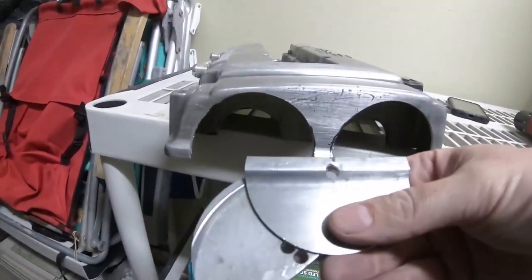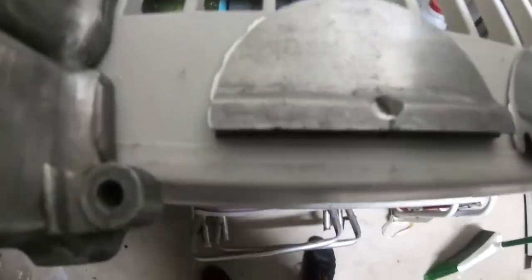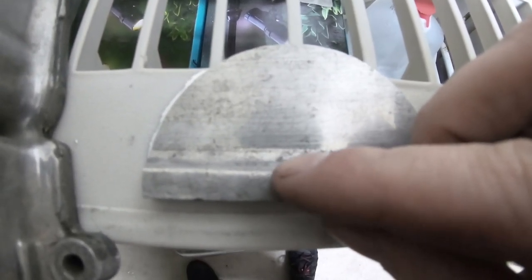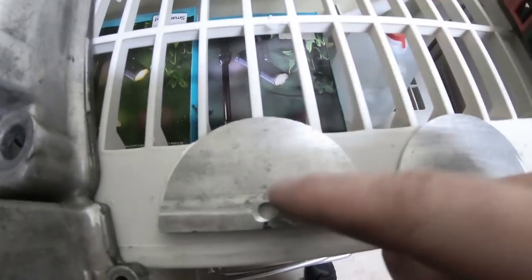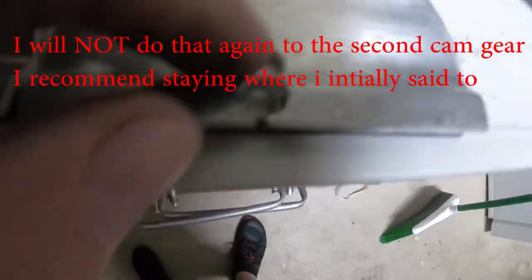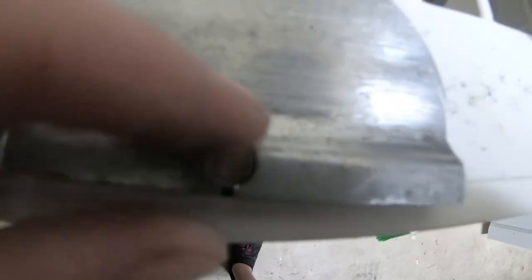Here are the two pieces that came out. The one on the left - I stuck with where I said to put it. The eighth inch drill bit went right above this lip so the diameter was level with that surface. Then the drill bit inside the hole saw went above it a little, but it came out good. On the other piece, OCD kind of kicked in - I actually put the eighth inch right where the radius of this matches, and then the eighth inch made it bigger.